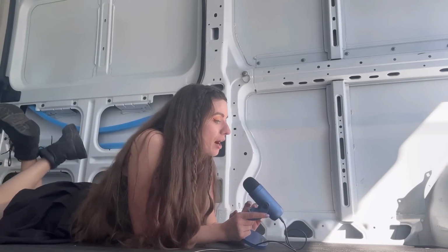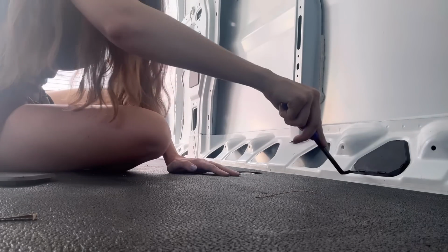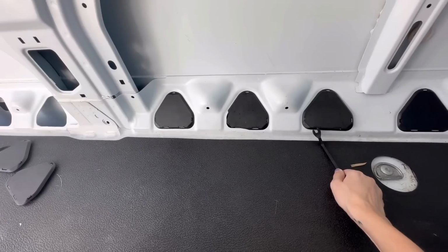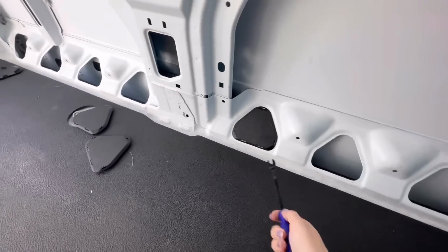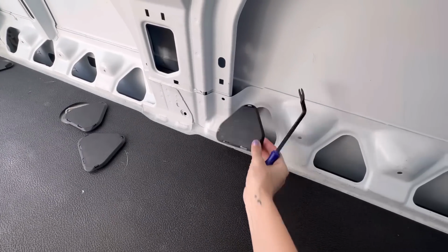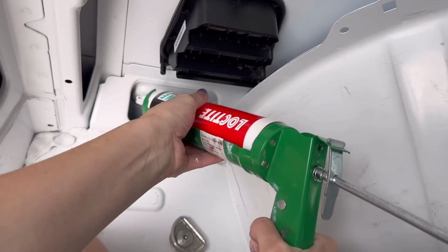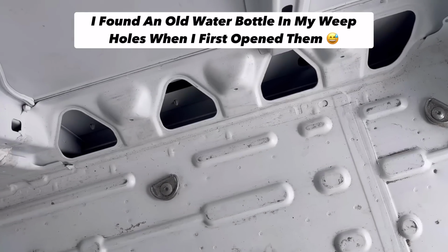Well, a lot of people seal up the little tabs from the rocker panels to help stop leaks and stop water from coming in the first place. This is actually a really big issue in Sprinters that can cause leaks. So if you have a Sprinter, I'm going to leave a link in the description of a video of a guy with a Sprinter who sealed up the rocker panels in a totally different way than I'm going to do it, because it's a bigger issue on Sprinters. But for me, I'm just going to seal up the little tabs on the inside and call it a day.